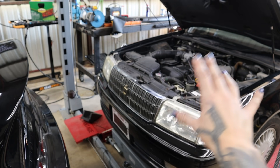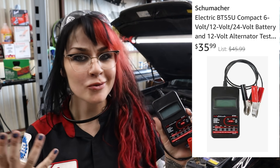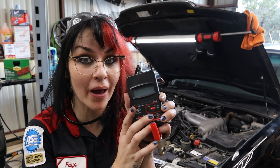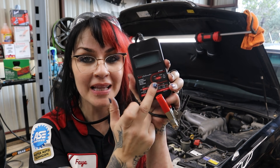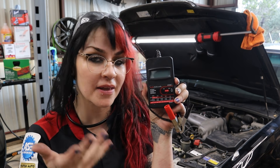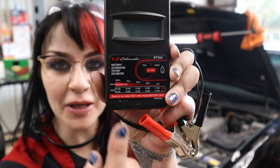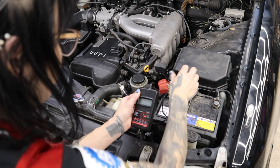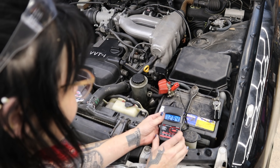Now that our battery's good, let's test the alternator. We're going to use this Schumacher BT55U — super affordable, great to have around. This also tests the battery as well, but it doesn't put a load on the battery. It will let you know if your alternator is charging within the specified voltage. One of these two little lights is going to illuminate — either red for fail or green for pass. Super simple. Right now, fully charged, we're at 12.84 volts.